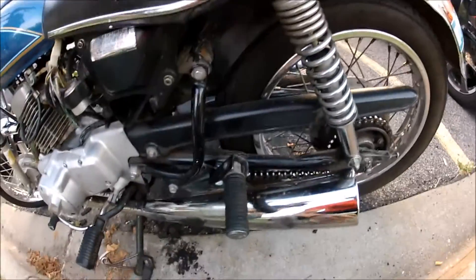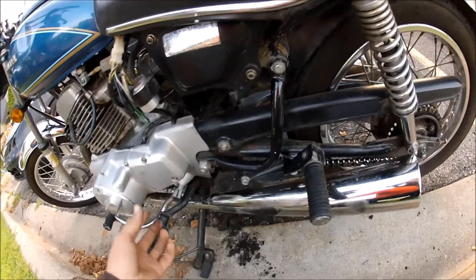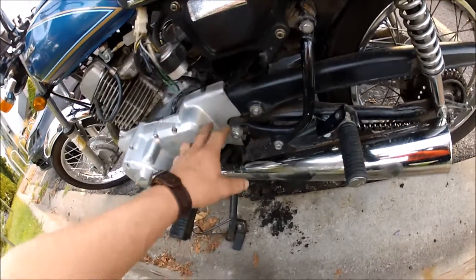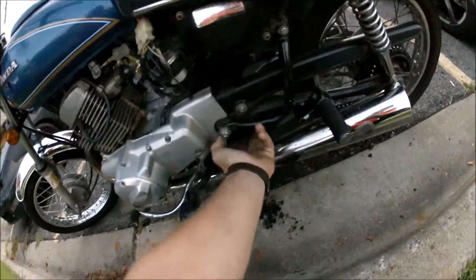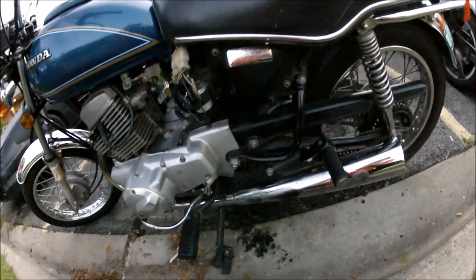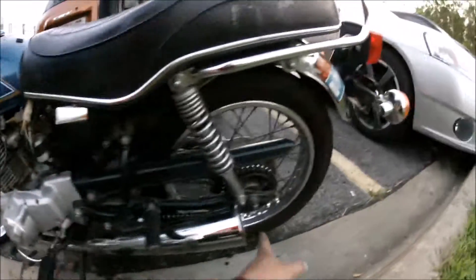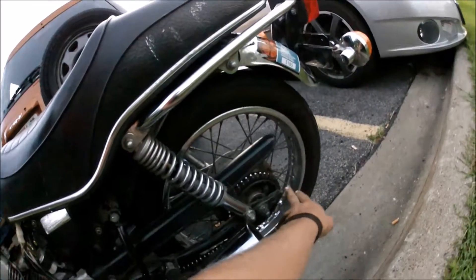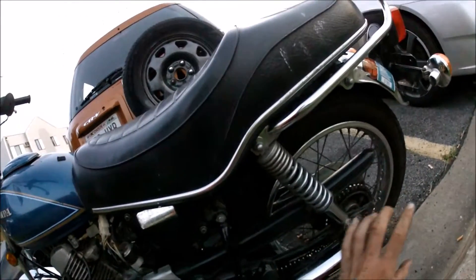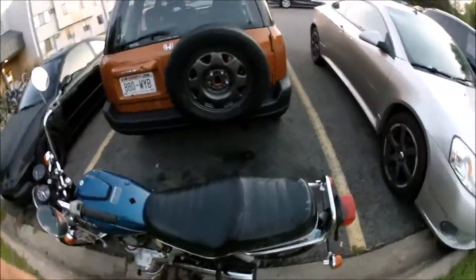So all I had to do — I'm guessing this chain hasn't been tightened up in the past 30 years. I pulled this cover off, fixed that, got that put back on. Pulled this off, put everything back on there, put my chain on. Because this chain probably hasn't been adjusted in a very long time and is most likely very stretched out. So what I had to do is pull out this cotter pin, loosen up the back axle, undo this screw a little bit, and then basically just shift the whole back axle down and back a little bit to tighten the chain up. So I did that and I took it out for a ride.